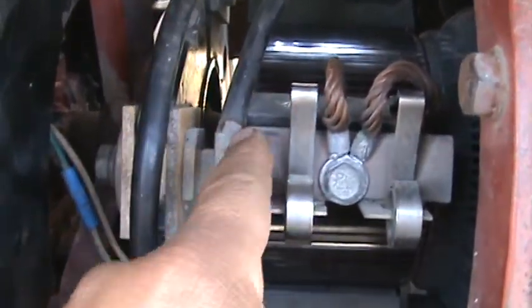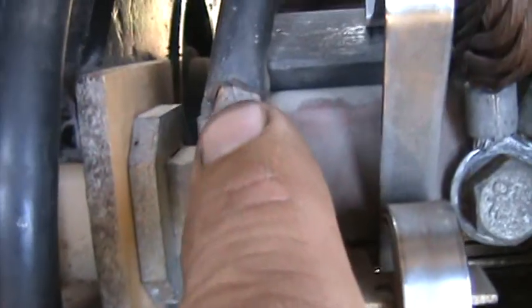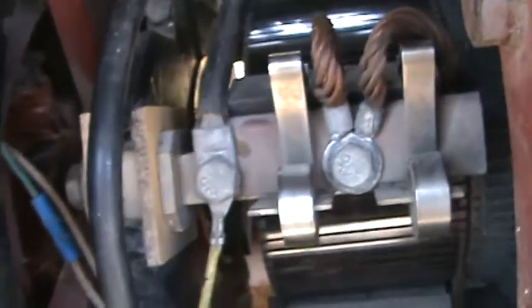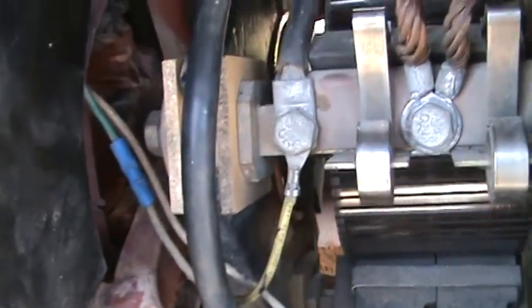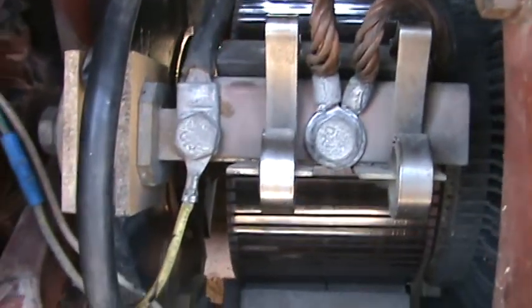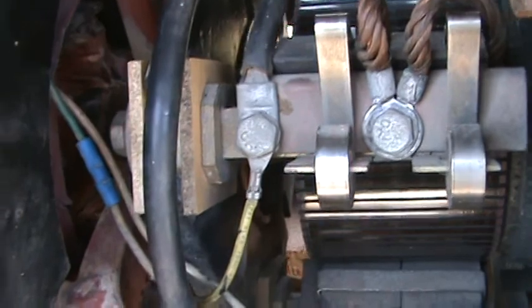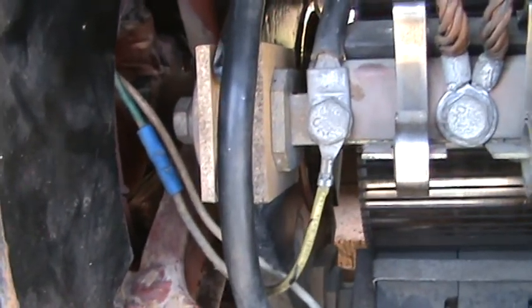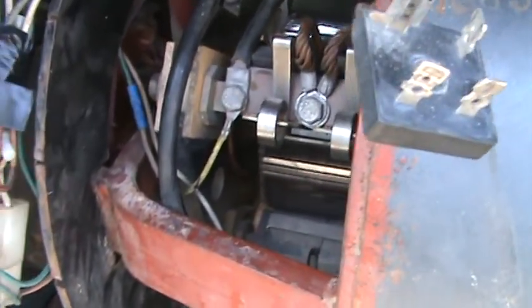These jumpers right here — they're all aluminum wire. You see that? Aluminum, not copper. Copper looks like this — that's copper wire. This aluminum is where the problems start. I'm going to go ahead and change this jumper from one brush to the other and put copper in. I can't easily change the winding coils inside — those are about $400 a piece — but that may happen someday.